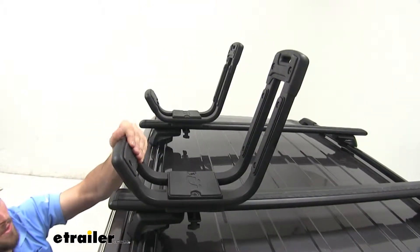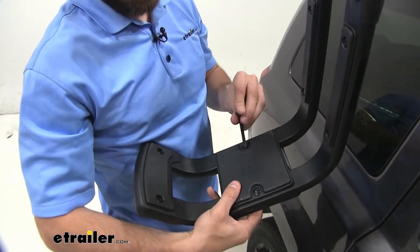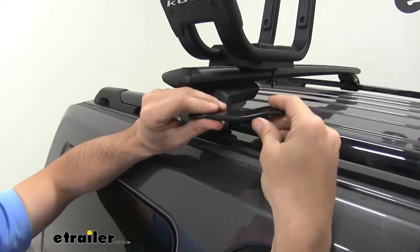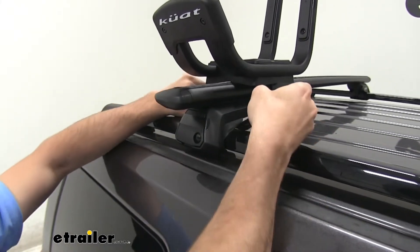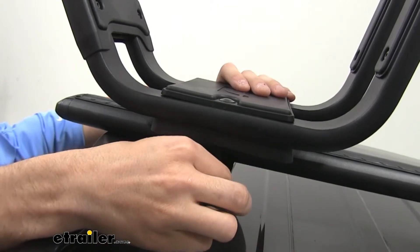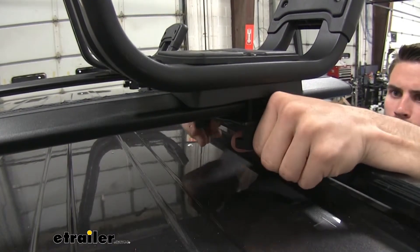To help protect your kayak, the carrier is going to have this nice soft rubber padding on the sides and the bottom. It's very easy to get installed — you just take your included bolts and put them through the slots. Then take it up and put it on your roof rack, making sure each bolt gets on both sides of the crossbar. You'll have this rubber coated plate — the rubber coating helps protect the finish of your crossbar. Make sure the side with the curve goes under the crossbar. Once you have it in place, hold it down with one hand and put on the wing nuts with the other to secure it. Tighten both wing nuts evenly so you don't get too much pull on one side.